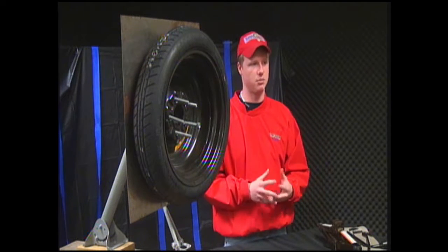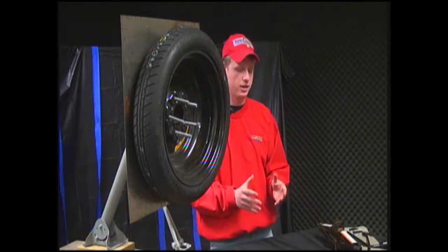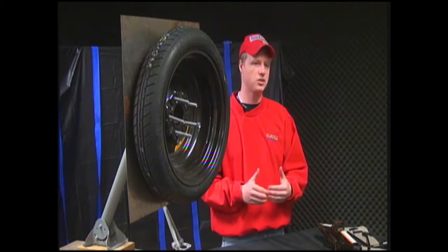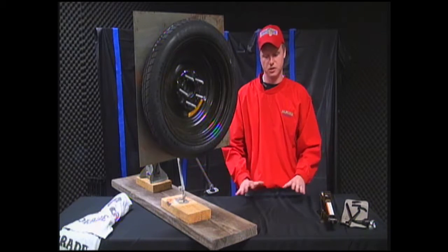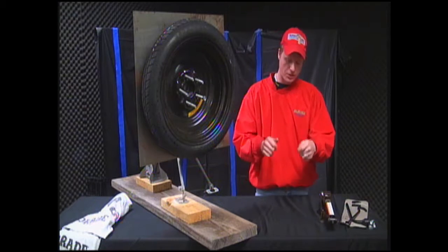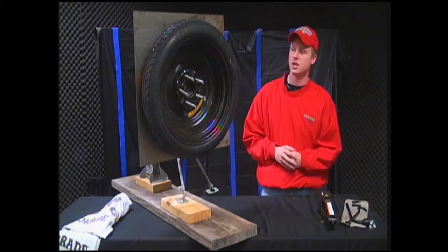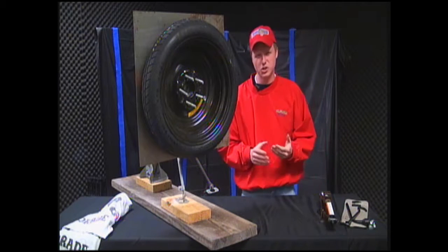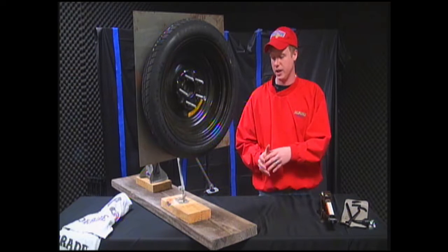My car, my girlfriend's car, my mom's car, that's all in the same spot. You want to go to the back of your car and open up the hatch of the trunk. Once you've opened that up, there's a piece of carpet that lays down underneath in the trunk. You lift that carpet up and there might be styrofoam. You just move that styrofoam out of the way and your spare tire will be sitting there. There's usually a stopper that you're going to want to remove. You turn it to the left, or counterclockwise, and it will remove the tire from its safety harness.